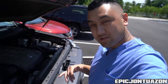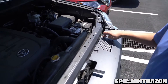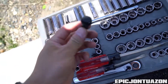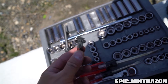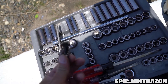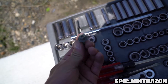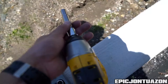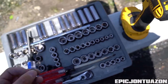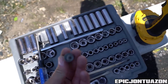The first thing we're gonna do is remove the grille. It's one, two, three, four Phillips heads and then two of these clips that pop out. This is the clip you're gonna be looking for — you stick a flat head in and pry it up and then you should be able to pull the whole clip out. I ended up using a 10 millimeter which works just as well — you can put the whole cap into the 10 millimeter and it'll pull it out just the same.